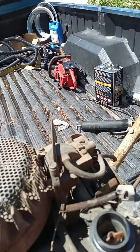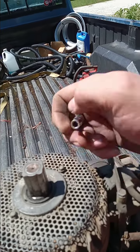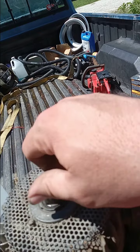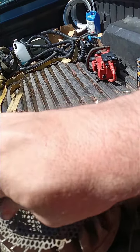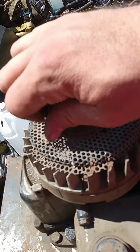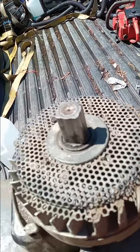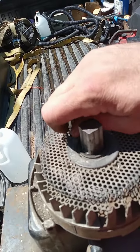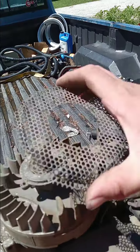So let's take the flywheel off. On these starter clutches, you can hear how dry and rattly that sounds. You're supposed to take these apart every few hours and lube them with a little bit of oil to keep them from sticking. But most people never do that. It's amazing to me how some of these machines run for 10, 15, 20 years without having the starter clutch lubed and they don't really give you much trouble. But the day one of them ball bearings decides to stick in the groove, then they give you all kinds of fits.